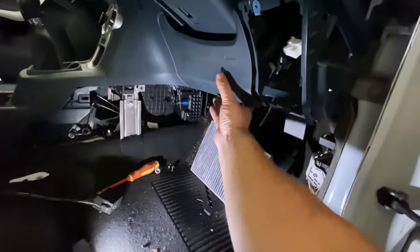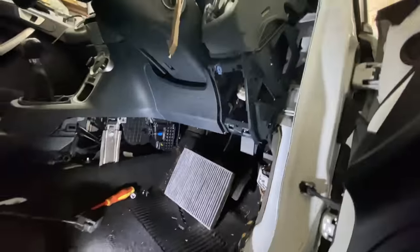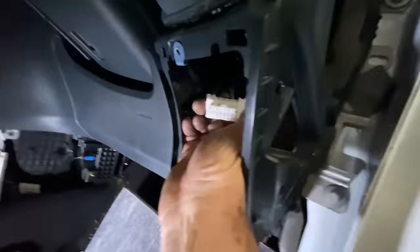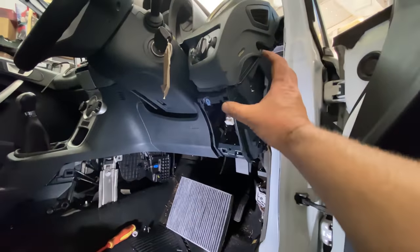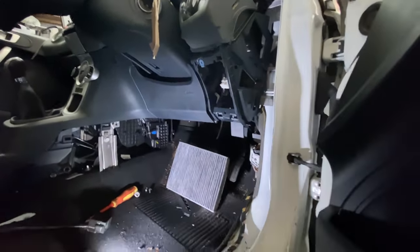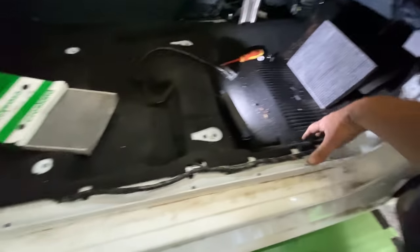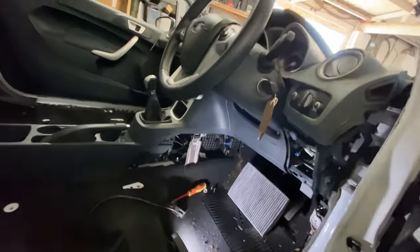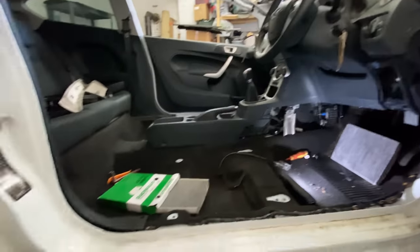All this has been done up tight now. The airbag is going to be up underneath the brackets, and that's been tightened up. So this side's really coming along now. I've got to put this back on with my OBD connector. It goes in the back of that, so that can go on and be screwed up. Little cover can go on there, so that side's done. Actually, this corner can go on, and this piece here can go on as well, but not the rubber. I might have to leave the rubber until the windscreen's done, but I could put the rest of the trims on, for definite.